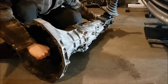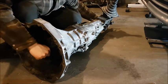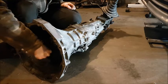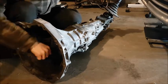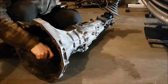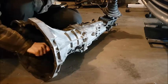You will notice that the rear tail piece is not spinning at all — it does if there's zero load, but once I hold onto it, it stops spinning. Now go ahead and put the transmission into first gear, and you can see when I spin it I can barely hold on because it wants to start spinning. As I change it into second gear, it'll start to spin faster with the same revolutions in my hand, and it'll continue to spin faster for third, fourth, and fifth — of course it spins the fastest for highway speeds.